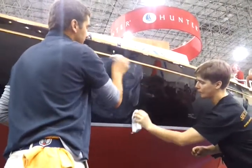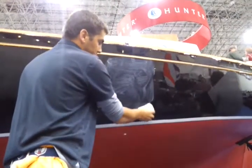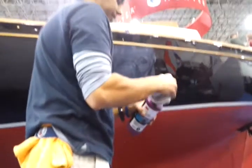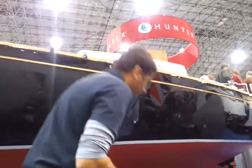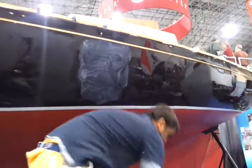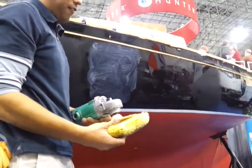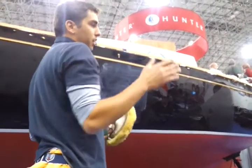One more thing. I put on a lot of product. I've talked to the product reps and guys who represent the product, and they say, man, you don't need all that. And I say, I like it. I like knowing that I have that much product on there. And whenever I teach employees how to buff, I want to make sure that they are working enough product, more so with gelcoat than with paint.